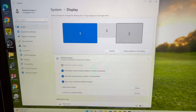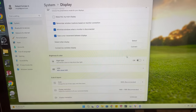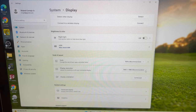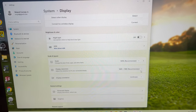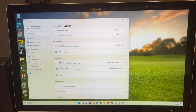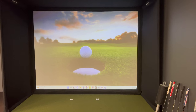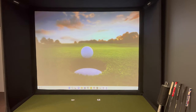Here you can see my three displays — the BenQ is number two. Going into display settings, you can set up your ratio and display resolution; it will recommend what's native. I set mine to 1440x1080 for my graphics card to match the image. I did have a difficult time getting it initially set up, but once I changed that resolution I was able to manipulate the image and it fits the screen quite well.